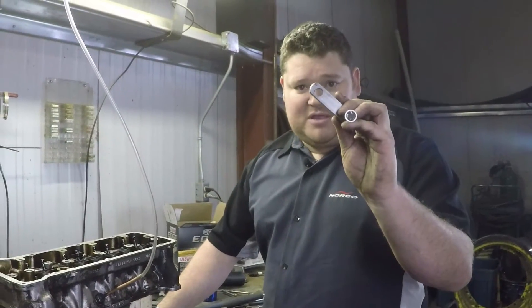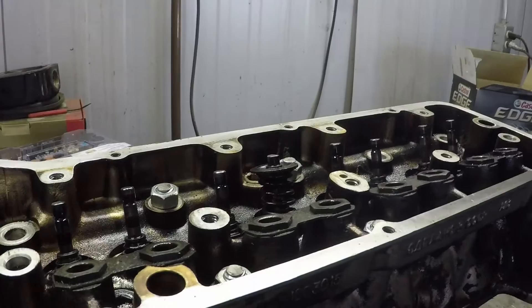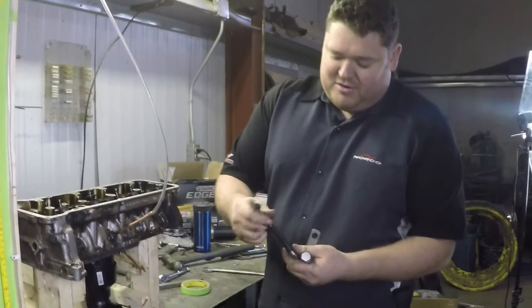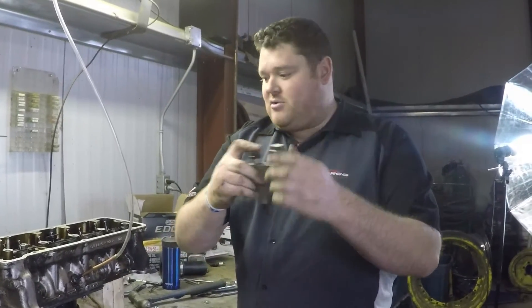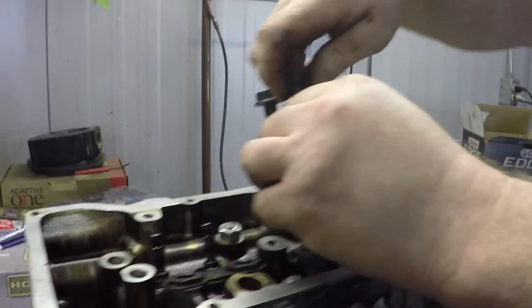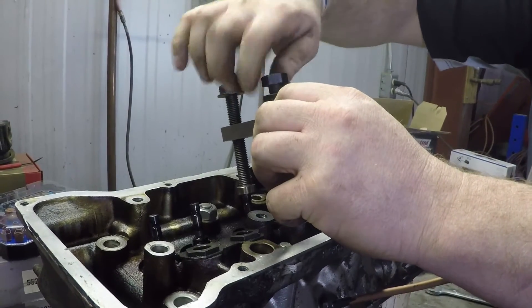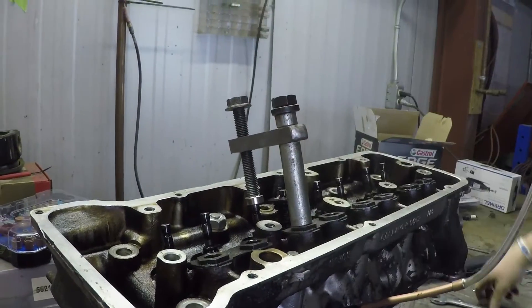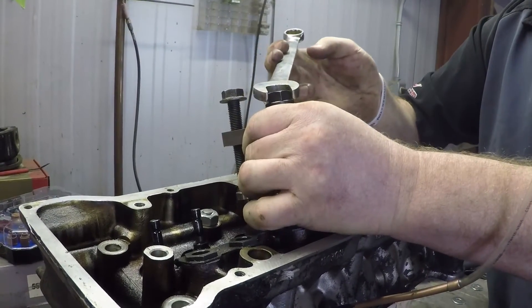After that it was a matter of drilling a hole in the other end so that we can bolt it to where the lifter sits on the cylinder head. Then I'm just using one of the factory Lada cylinder head bolts with a couple spacers that I made out of some conduit. It's quite simple — a little spacer through the piece, big spacer on the back side, screw it into the head. Then we tighten it all down and as you can already see it hooks into the valve.